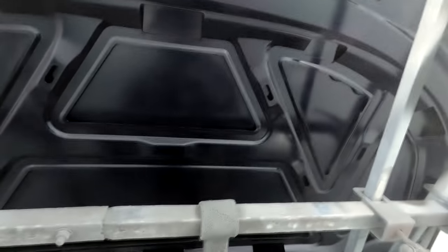I used to do this years ago, but I would put it on in the second coat, in between coats of the outside, and I was finding that it would land on the outside and give me a funky, silicone-like effect, so I stopped doing it. So I had an idea to do it again, but do it first. As long as you do this first, it's okay. So we use the Chromax AK350 fade out thinner, and I can see already that that's a really nice semi-gloss finish, and that replicates the factory finish perfectly.